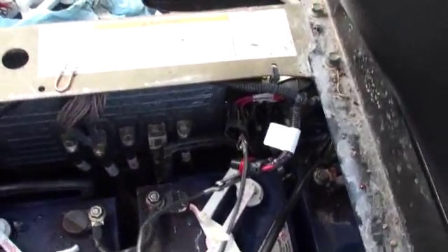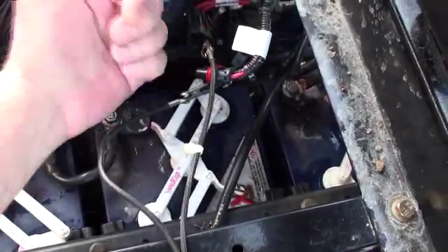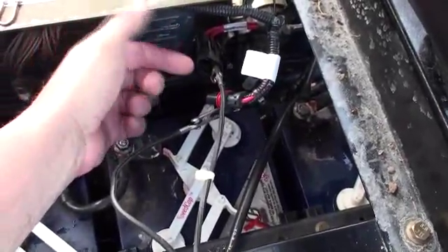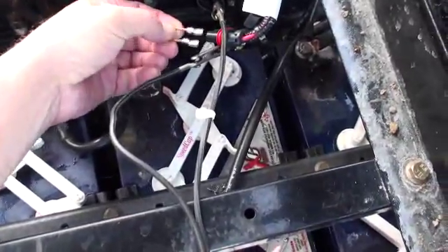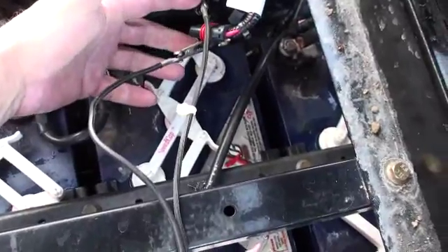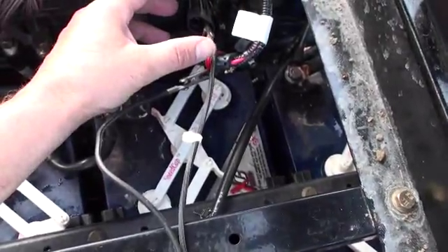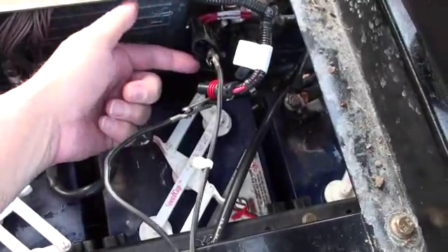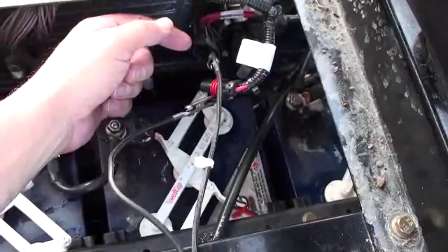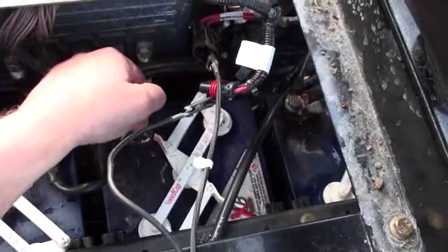What I'm really doing — the whole gist of this — is that you're breaking this connection, and then you need to basically connect these wires back together, but you need to be able to do it from up front where the charger is. So you separate this, use a little jumper, put my connector on there, and then on the other end I'm connecting the other two ends. Basically it's like plugging this plug together and separating this plug back apart, which is putting 48 volts back up through these wires. I'm just basically making and breaking this connection — that's all that's really happening on this end.